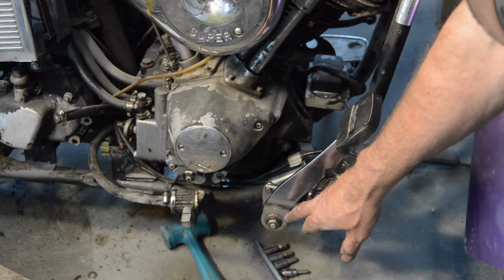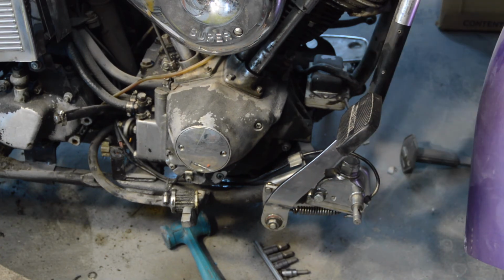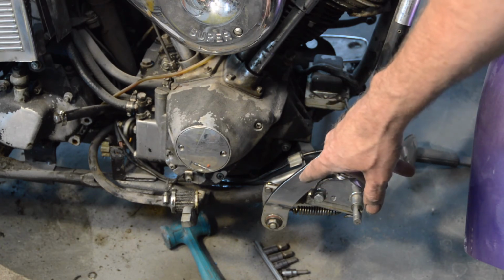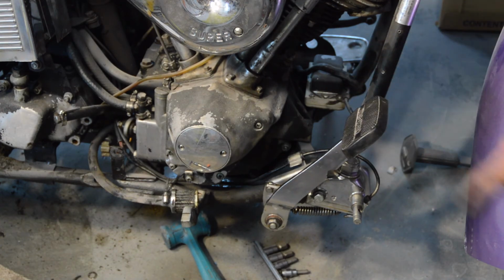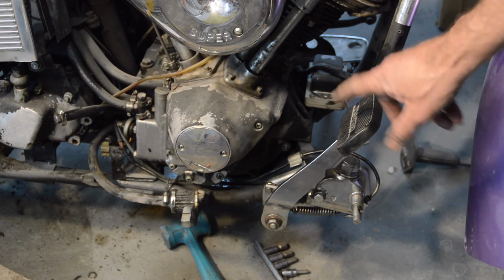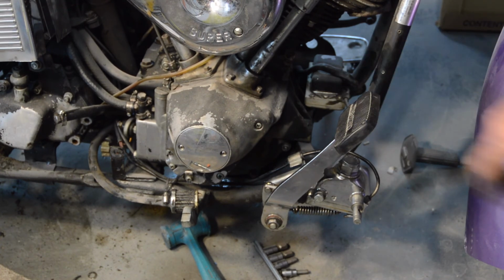And then where this nut sits on the pin, there's still sideways movement on the pedal, which contributes to the rock. Therefore, I have preloaded it sideways with a couple of fibre washers and then a flat washer over that to compress them, and then the nut holds that against the pin. As you can see, there's no fluid in it at the minute, but it's perfectly free, and I can adjust the tension anytime I like, but no wobble. Absolutely no wobble, in fact. So, really good. So that's the good news.